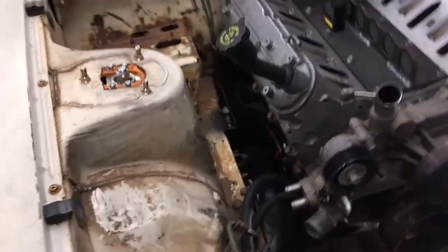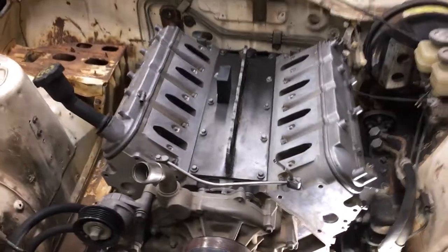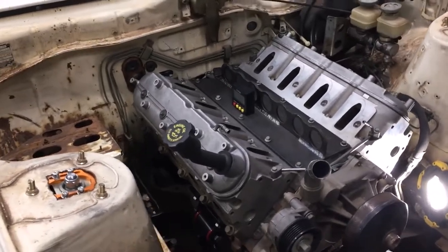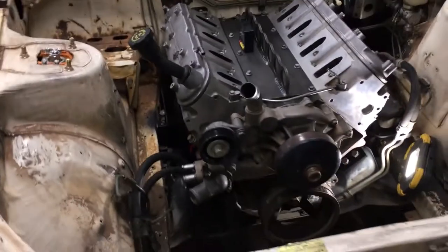The motor mounts are in. That transmission mount is solid now. It definitely was failing because of those bushings. After we welded those washers in, it basically made it a rigid mount point on both sides. So that thing's not flexing or moving at all.